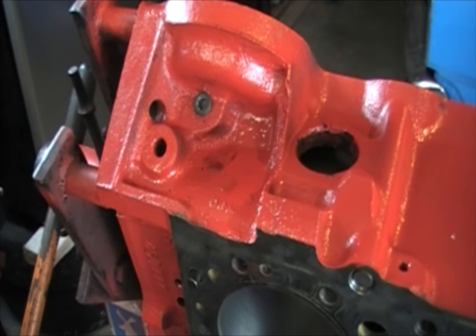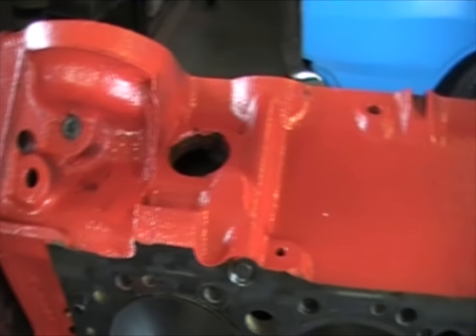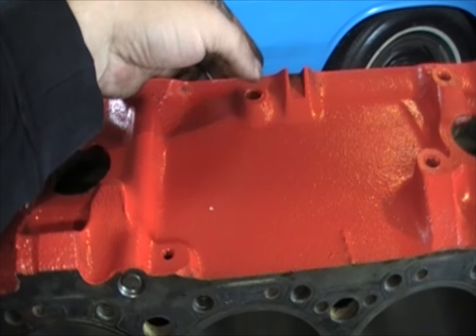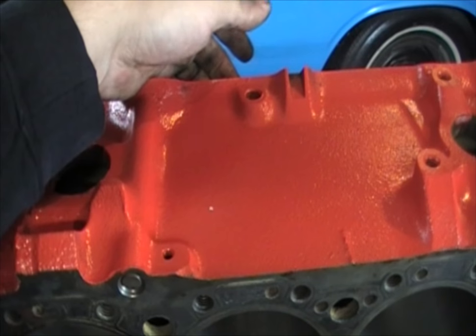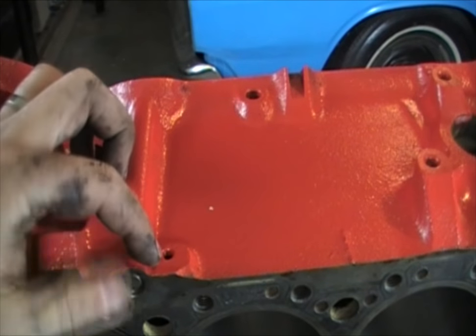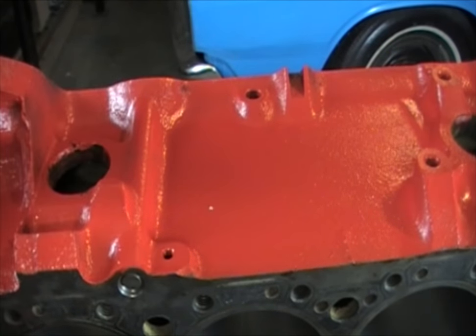Pretty much if it has oil, I don't recommend using RTV. These holes down here at the bottom are connected to your water jacket, so if you're not going to have a sensor in there, you're going to want to plug this up. Some of these are also connected to water jackets, so you're going to want to throw a bolt in there or something like that. And other than that, that's pretty much it.